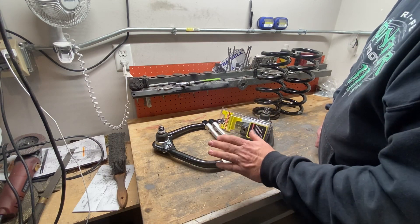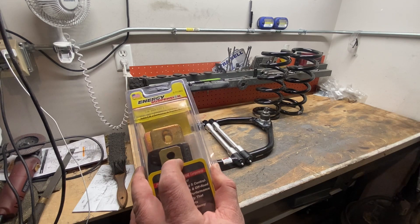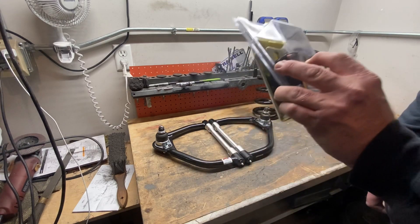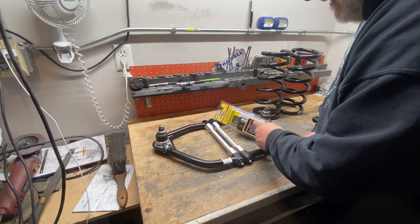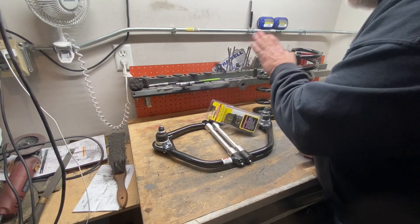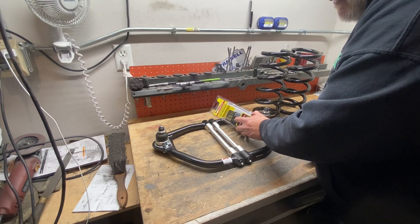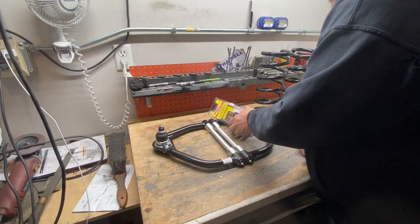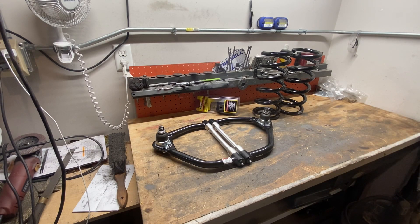Live and learn — I cut 200 thousandths off my original Energy Suspension transmission mount to try to lower the back of the transmission and ruined it because there are no threads past what you can see, just a hollow void below. So it's going to be a lot more work: I'm going to have to section out and plate in the middle portion of my transmission crossmember in order to set the correct transmission geometry.